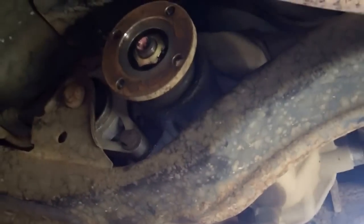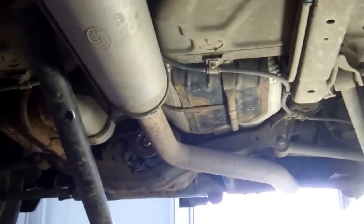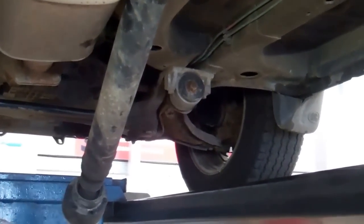So we should now be able to drop that prop shaft down. You can see that's the rear prop shaft down. If you zoom back a bit, Kate, I can get it in view of where that is. So you've got that dropping down. We should drop down this front one now. So if you spin around. Now you do have to push it back a little bit. Alright, and that's the front prop shaft down. So now you can see we've got the prop shaft just hanging by the mounts in the middle. So I'll get a 10mm socket and we'll do that now.